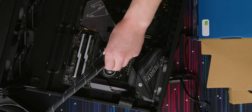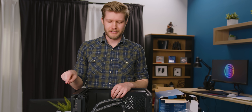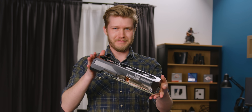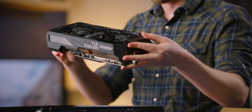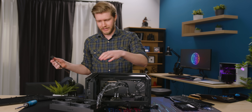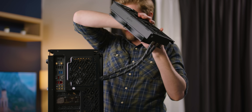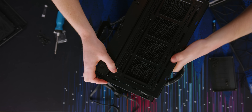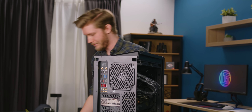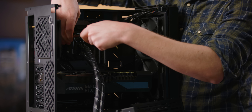A scooch of MX4 here. If you're building in this case, you should not install your AIO before you put power to everything — I would do that last. For a GPU, we're going to be using the Aorus RTX 3080 Extreme 10 gigabyte. It's fricking huge — I think we have just a couple of millimeters of clearance. This is a very big cooler. Taking the top out is pretty fantastic because now we can drop this down in here. It does say up to 240 on the top — this is the 280. Doesn't fit. Not even close. So long, Arctic — you sent us a cooler that was really easy to put in, but the one you sent us is too big.